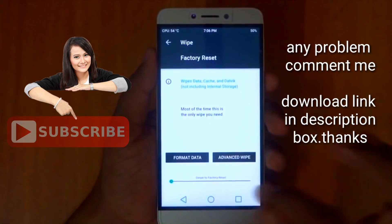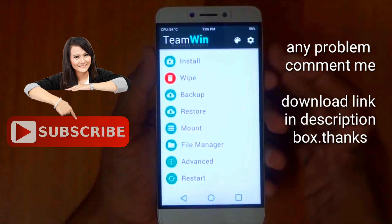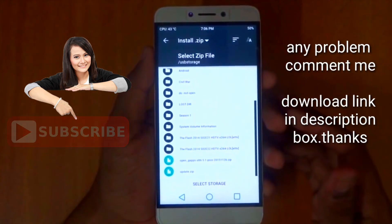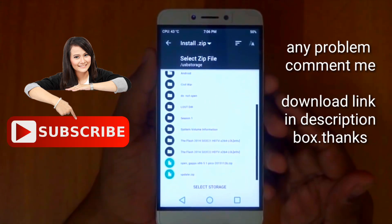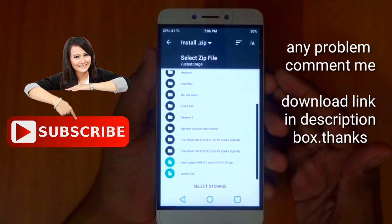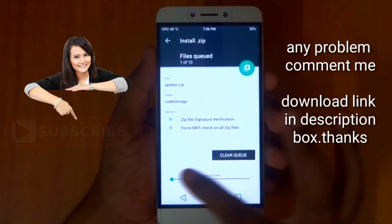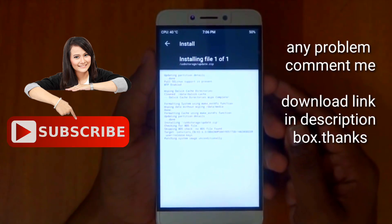Now go back. Choose the location where you have downloaded and kept the ROM — mine is in USB storage, in the Updates folder. That will be the file. You can head over to the description to get the download links. If you don't have TWRP installed or are not rooted yet and want to install TWRP, check the description — I have provided links on how to install TWRP. Now let's flash the update — just swipe to install, just like flashing a normal ROM but without GApps.